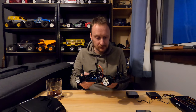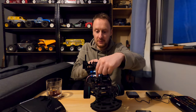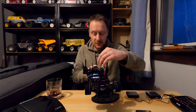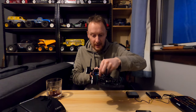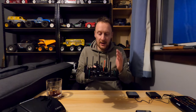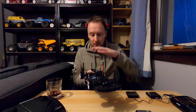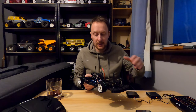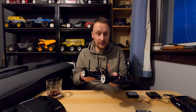I'll show you that in a minute. The speed controller is here — it's much heavier than the receiver, which is here. So there's not much room. I might need to lift the receiver and put a weight under the receiver and stick the receiver to the weight, which should keep the weight still quite low because the receiver is so light. Depending on how close I am already to this 950 gram limit — I haven't got the body shell on yet, I haven't cut the holes yet — we'll try it out today, although it will be a little bit lighter than it will be running. But it'll give us an idea of how close I am to the weight limit.